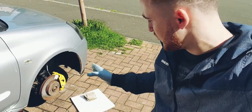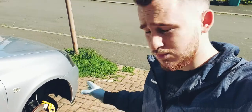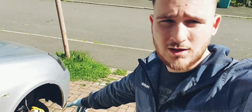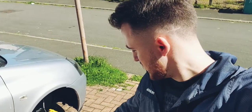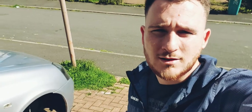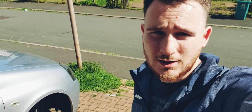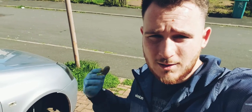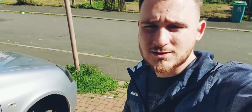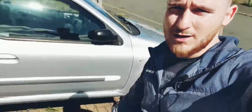So there's the caliper — I put three coats on there. All you have to do is wire brush it and use brake cleaner, brush it very well, then spray some brake cleaner, and after start doing your paint. The way I do mine: I put a coat, leave 30 minutes, put another one, leave at least 30 minutes, and after I put another one and leave 40 minutes to one hour just to make sure the paint is hard enough. I've done the same on the back — I've only put one coat on this one so far.